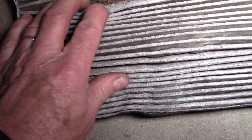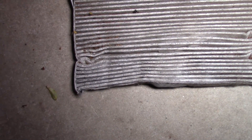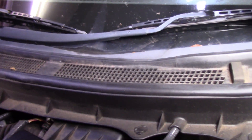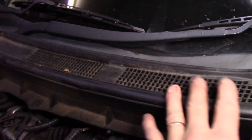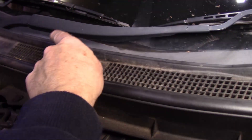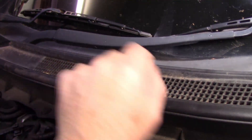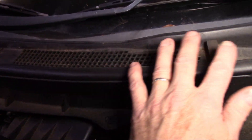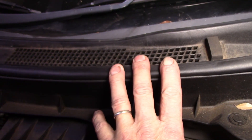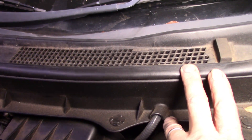Half a tree in there. This guy looks like he's parked underneath a tree at some point. There was a lot in his scuttle panel. The scuttle panel is this panel here which usually houses the wiper arms, and that tends to fill up with leaves etc. I've cleaned it out now with some compressed air. This was chockers full of leaves all in behind the wiper arm - mud and leaves etc. And that's not good for rust of course. But also it won't allow airflow into here. So we need to get rid of all those leaves so that you can give your cabin filter the best chance of getting some fresh air to filter it and then put it through the HVAC system.